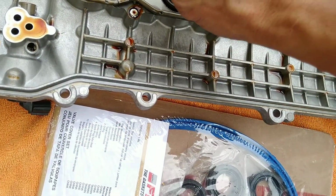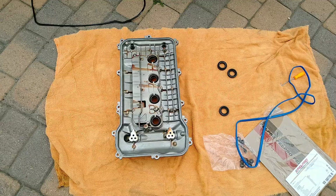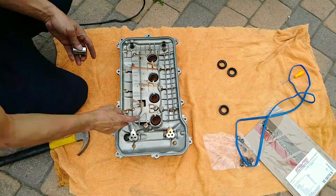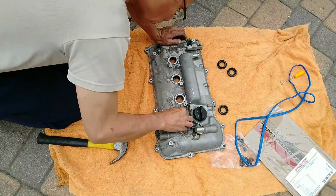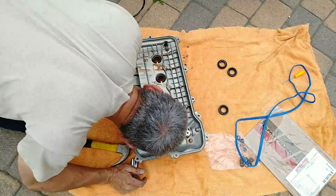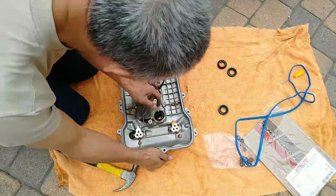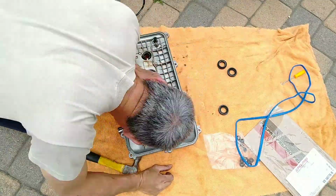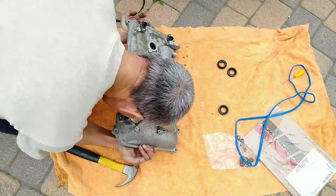So yeah, these are very tough parts to change. See that bolt right in the middle there? If you don't remove that, you're not gonna take this out. So I used the socket to tap it out. Remember, I told you about that part that broke. See those 2 valves on the right there? Make sure you remove those, because they include gaskets to change them out. So remove those before you do this. Otherwise, you're gonna see I made a very expensive mistake here. I will explain to you at the end.